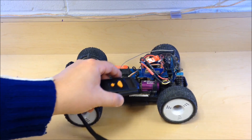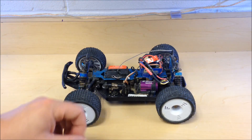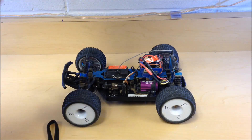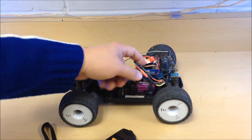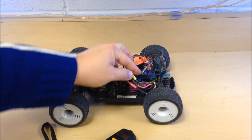Things you can do to prevent overheating: first, stop running. Second, keep an eye on the temperature with the temp gun — after a couple minutes of running, check if there's overheating and stop if needed. Other measures include putting a motor fan on, or adding ESC fans. This one doesn't have one on it.